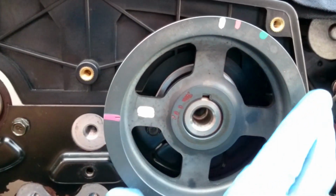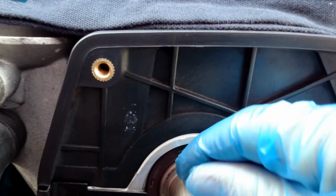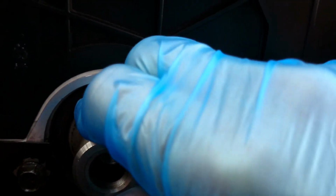Okay, so the wheel is on the shaft now. What is important when we're putting on this small pin here, it's a half wheel which is moving, and you need to make sure they are in the flat correct position here. You must not miss them. It's an important part. Without this the wheel might move in the rotation, so that will damage the engine.